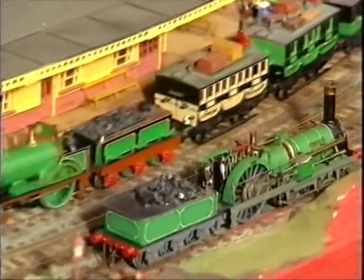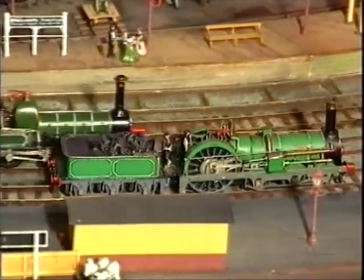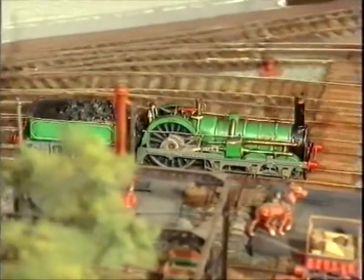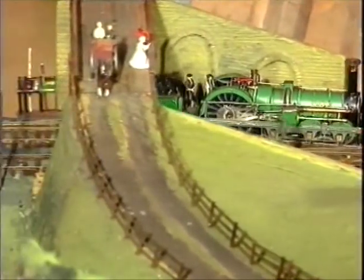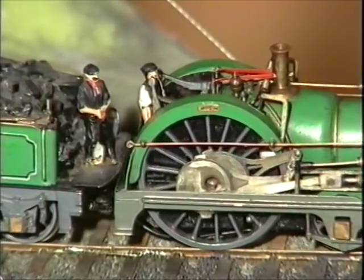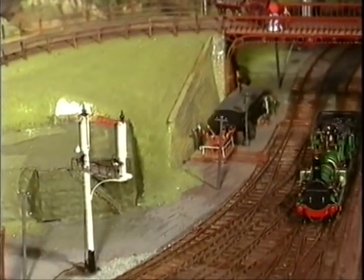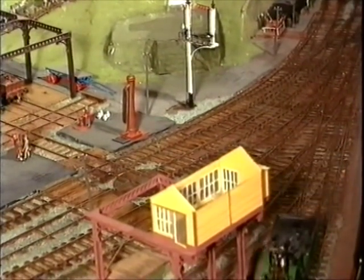The model of Liverpool, which is backing down from the head shunt now, is something like 20 years old and is one of the only examples of the free bogey system whereby the front four wheels are cosmetic and the tender is resting on the foot plate of the locomotive. This gives you a lot more traction because the Crampton relies purely on that single wheel to haul the train along. The large sheaves on the driving wheels are two foot nine diameter and had to be lubricated over the side of an oil can quite frequently to prevent trouble.